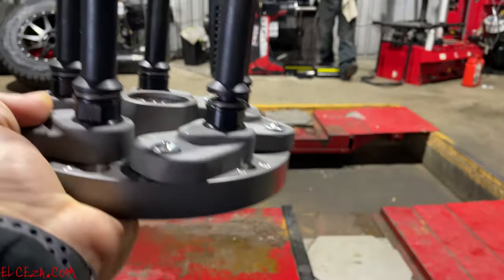You spin that tire up, it comes around, you put weights on it, the spindle is threaded, everything is correct, but yet it chases weights. I don't have three underneath it. I have nothing going on, and they call me and it's chasing weights, and I come out and put an assembly on it, spin it a dozen times, and it gives me the exact same weight every time.